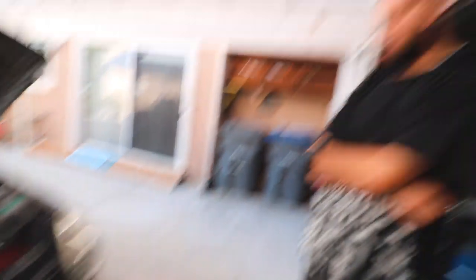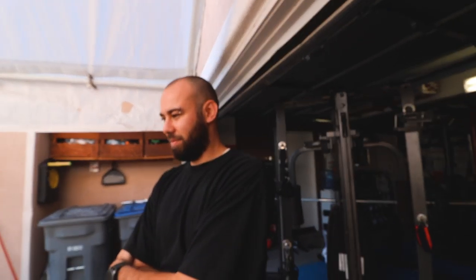Replacing these pulleys, which turn all the belts, is going to free up some power. It doesn't add power like a turbo, but it frees it up so you can use more - technically like an intake. That's also why we should get a lightweight driveshaft, especially if you're NA or boosted later, because that's a big portion of the rotating mass going all the way to the rear wheels. Even the Z's carbon composite driveshaft is still really heavy - an aluminum one cuts the weight in half, but the factory did it for rigidity, not weight savings.